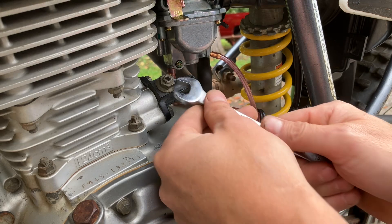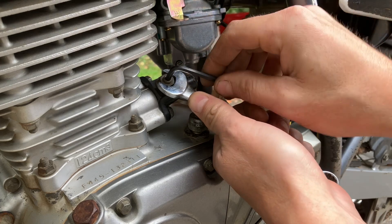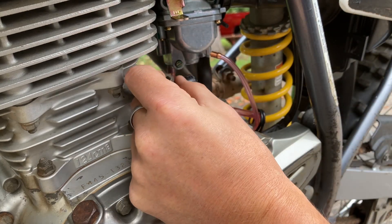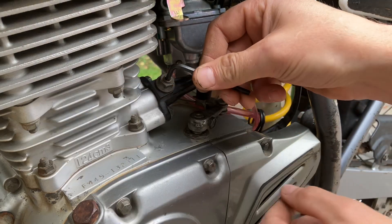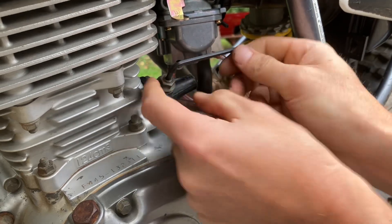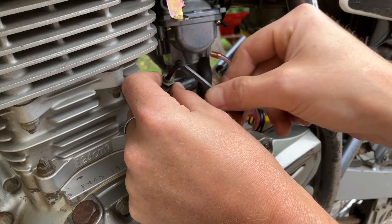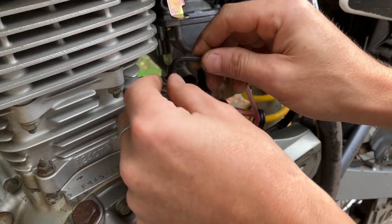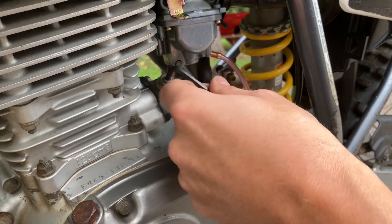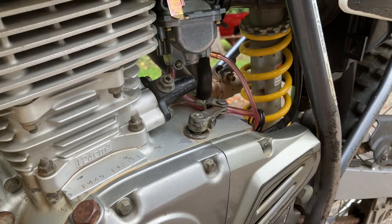To adjust this, you're going to need two tools. You're going to first need a 12 millimeter wrench, and then you're also going to need an allen wrench that fits in that little keyway there. So I'm going to go ahead and first back that off — which was nearly just hand tight. Then what you do is back off this set screw. I don't think this has ever been done before. Once you back it off, you just go ahead and lock this down again, pull it in place, cinch down that retaining nut, and that's all there is to it.